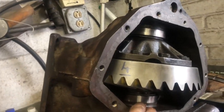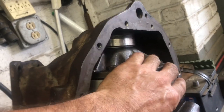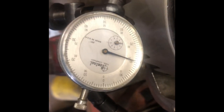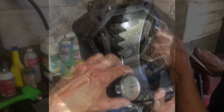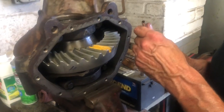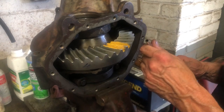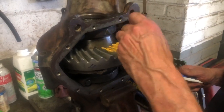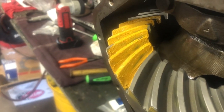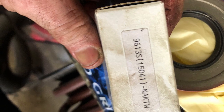At this point we have no shim on this side, and we've got the thicker of the two existing shims on that side — and that was tapped in with some force, putting some preload. The field test feels about right, so we're going to put these caps on and check the backlash. Our backlash is down. Now we're using the actual GM marking compound — you could use regular grease; that's all this is, yellow grease. It just helps you see it because it's yellow. You just paint both sides of some teeth, run it back and forth, and see what lines up. You put a load on — that looks pretty good. So I think we're looking good.